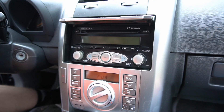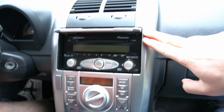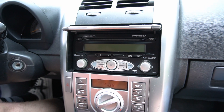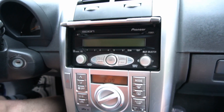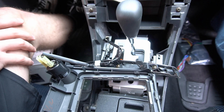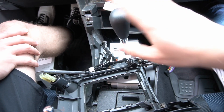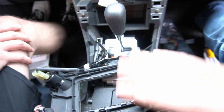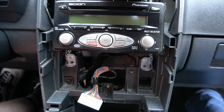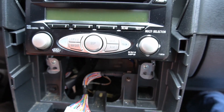We're inside the car now. It looks like you need to take this panel off to get to the actual factory stereo. We'll remove those and I'll show you where the bolts are so you can get a better idea, specifically for the Scion. We actually had to remove the accent around the shifter — we just put it in neutral and removed that to get it out of the way. You'll be removing these two bolts and then these two bolts back here, which will allow you to pull the whole unit out.